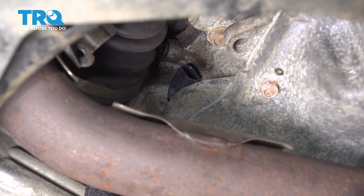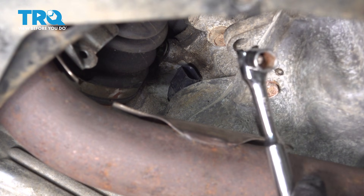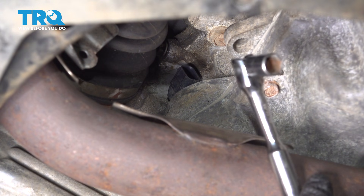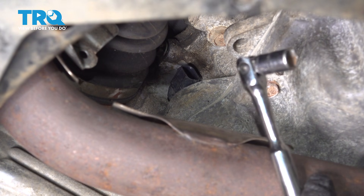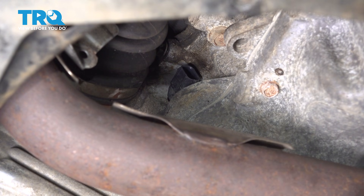If you were to spin the axle, you're going to find that the axle itself does have several dimples making their way around. If you spin it in the proper way, you're going to have a little bit more access. Essentially what I'm going to try to do is break this free using my breaker bar and a 10 millimeter socket — it's pretty much the thinnest apparatus I have. Once I have it broken free, we'll remove that bolt.